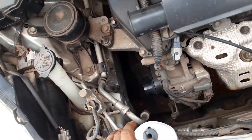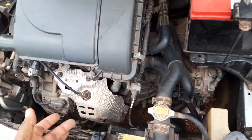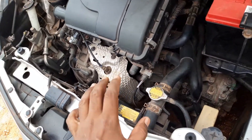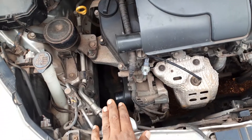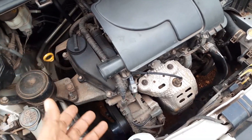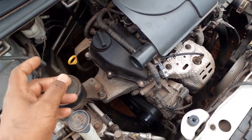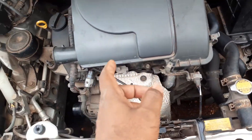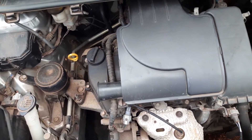I'm back on the water issue inside the engine bay — never spray water inside here. When washing the engine bay, I know a lot of us love to see our engine area very clean, no dust, no grease. But it's not a good thing. On older vehicles with no sensors, you can spray water wherever you want, except covering the carburetor. But with these modern engines that have a lot of sensors, do not spray water inside here to wash it — it's definitely going to get on the sensors and cause a lot of problems in the long run.